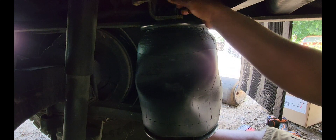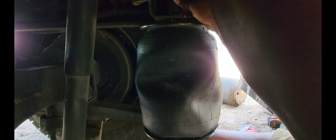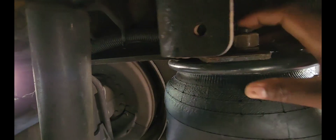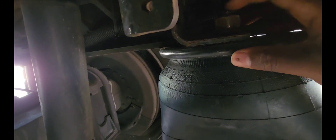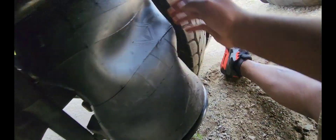We're going to get our nuts and use our 30mm to tighten it down. We have the washer — put the washer on top first, and then we have the nut. We grab our 30mm to hand-tack this first before we put the power tool on there. I like to hand-tack things first before I use a power tool. You guys can see on top here — we have the opening section to connect the air nozzle. Then we're going to leave this for now and go underneath to tighten the bottom one before we come back to put the air nozzle on.